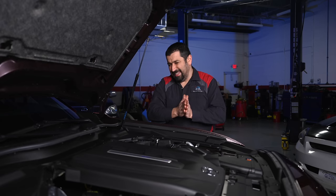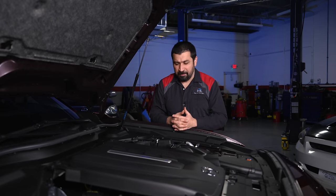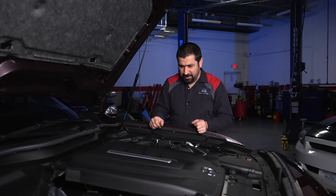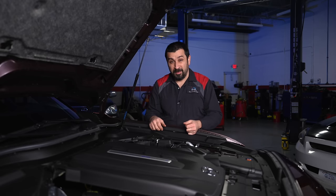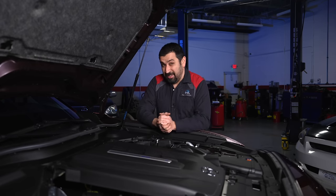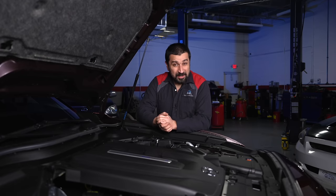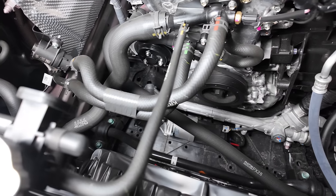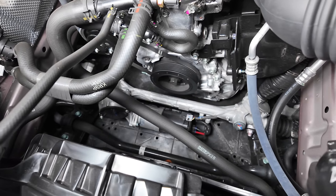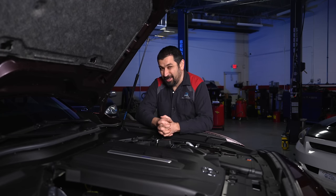The engine is in a longitudinal orientation, which mimics a rear-wheel-drive car that has drive in the front. Because the car was designed for the inline-six to sit as far back as possible — so there's not much weight hanging over in front of the axles — this engine is pushed way back, though access to the back is easier than with the inline-six. There's actually a lot of room in this engine bay. The cooling system is extremely simple: a mechanical water pump with a stretch belt, which is the only belt on this engine, as we'll explain when we cover the full hybrid system.